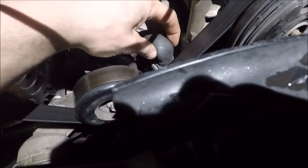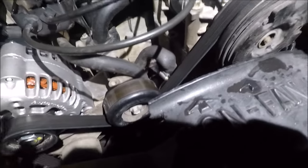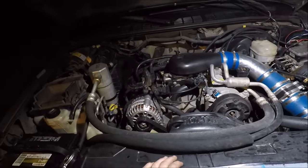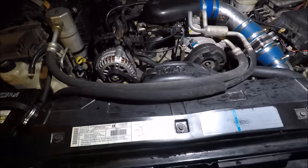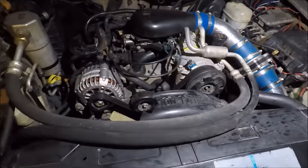If you can hear the whining, then you know it's the idler pulley. Another thing is this bypass hose here — it'll dry and crack, and a lot of times it'll clog. I just did a timing chain, water pump, and timing cover. With that stuff it was very simple. You pull the timing cover off, but stupid thing is 97 and up they got rid of the steel timing cover and threw a composite one on there, which you had to replace upon removal according to GM.